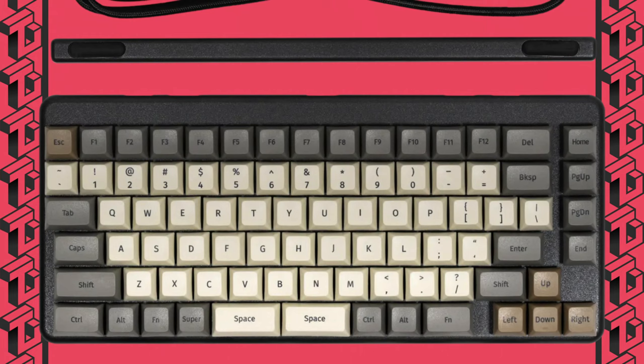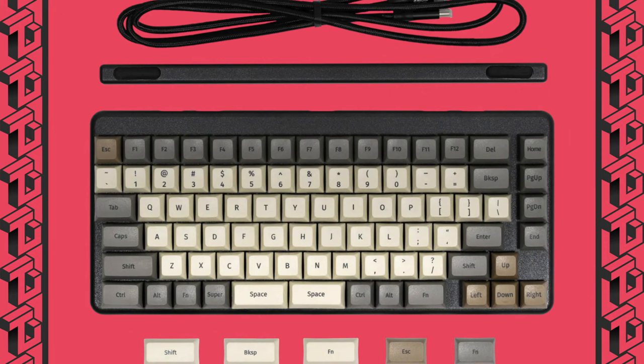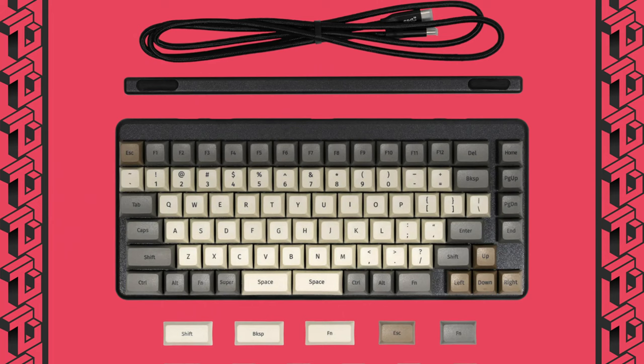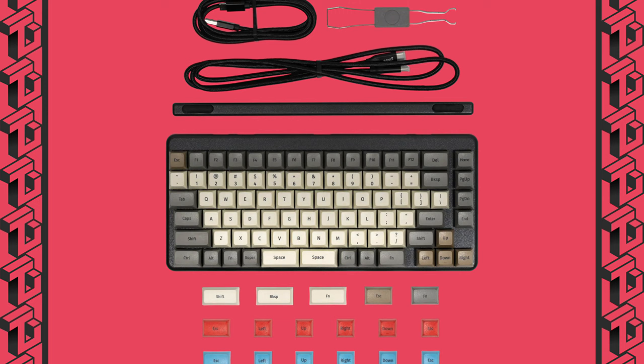Your keyboard also acts as a high-speed USB hub. Besides the USB-C port used to connect the keyboard to your system, 2 USB 3.1 Gen 2 USB-A and another 2 USB-C ports are provided for daisy chaining. The keyboard also features individually addressable RGB backlit keys with keycaps manufactured of PBT plastic with a dye sublimated legend.